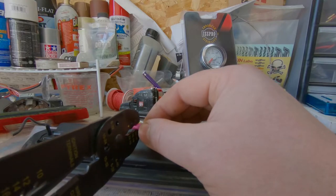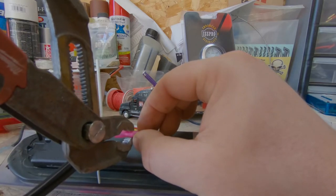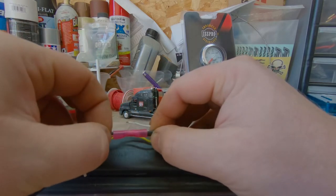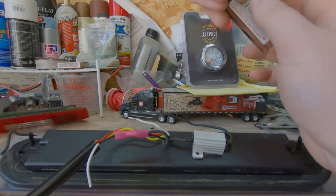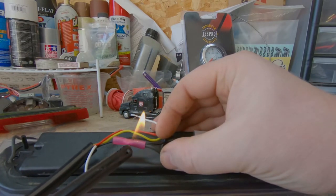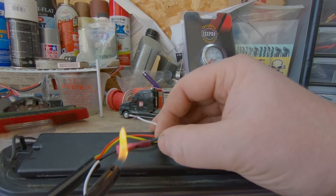I don't have my good crimpers here, so we're going to make do. Make sure the wires don't pull out — none of them do. Now that's just the heat shrink part of it moving. We'll take a lighter and heat this — it's actually going to shrink down on the wire. These have glue in them too, so that glue attaches itself to the wire as well. Going to make sure nothing moves. So that's one side.